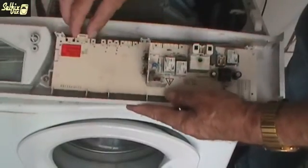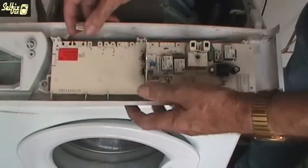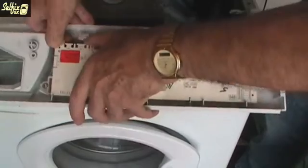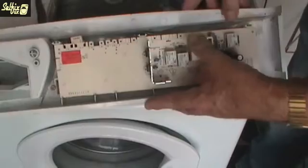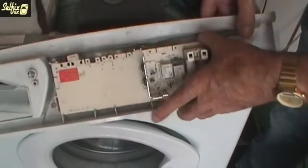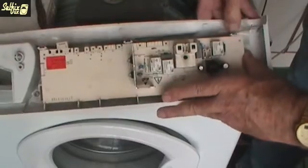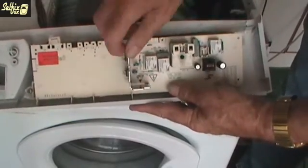Make sure you remove all the edge connectors before unhooking the module. When all the terminal blocks have been removed, bend the little tabs away from the module as you ease it up. When all three have been released, the module will come free. Just hold the edges of the module and use the aluminium bracket in the centre to grip it by, just in case it's not the module that's at fault — touching the components on the board could cause them to short out.